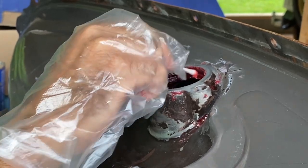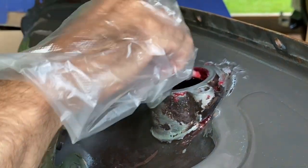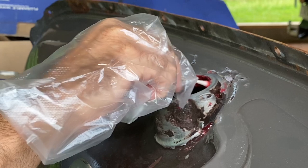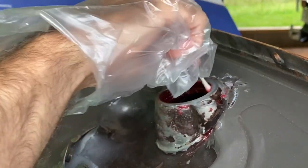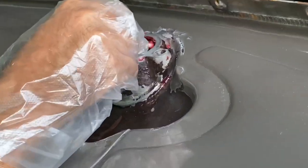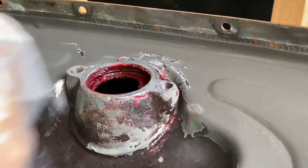If you just do this for a couple hours, it'll finally come off. I did use a wire brush, but I'm trying carefully not to get any particles down in the gas tank. That's the reason I'm being very gingerly. I'm wearing gloves and I'm outside, so this stuff is pretty strong. Take all precautions you need to eliminate fumigating yourself. You have to make sure that you don't booger up these threads — once the threads are boogered up, you're really sunk and may have to replace the whole gas tank.